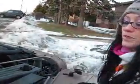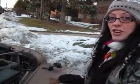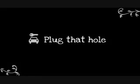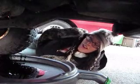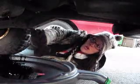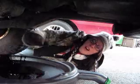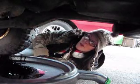But make sure after this whole thing and after your oil is drained, you put your little plug bolt back in before you pour oil back into your car, because it will just keep draining. Okay, now after your oil is completely drained, like I said, make sure you put your little plug bolt back in. That's like the main key, because if not, your new oil is just going to drain everywhere.